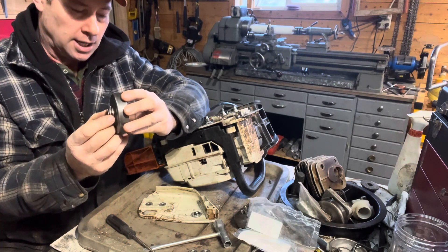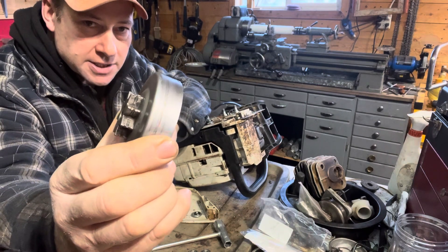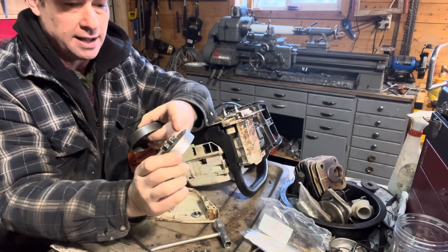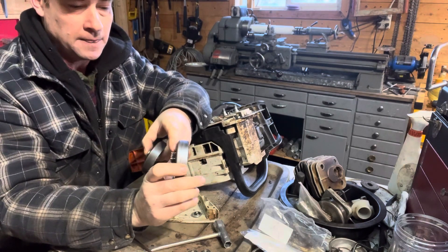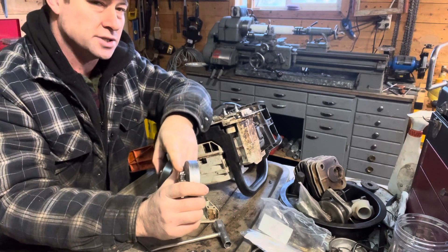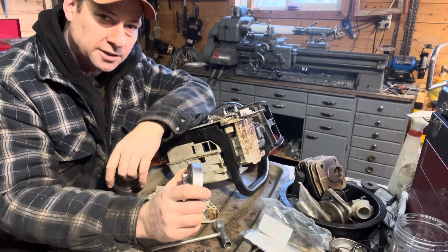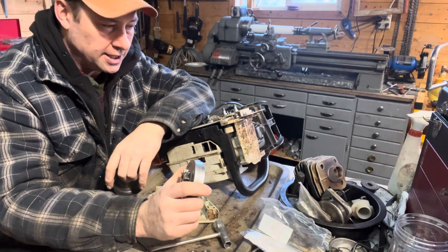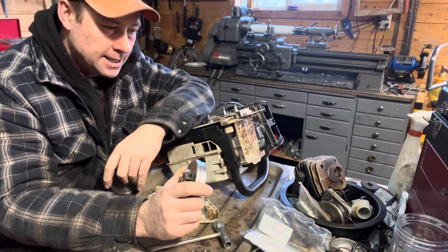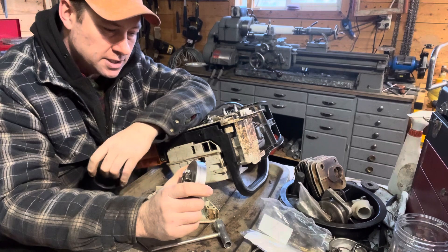Like I tried to explain in the previous video, these do float, so it actually helps the alignment. You can see the little damage — or at least I think you can — on this spur where it's all chewed up. What happened is it actually affected the drivers on the chain, so I think there are three chains I'm going to suggest the guy just recycle, because trying to get all those burrs off is going to be a pain, and he'd be paying my shop time versus just buying new chains.